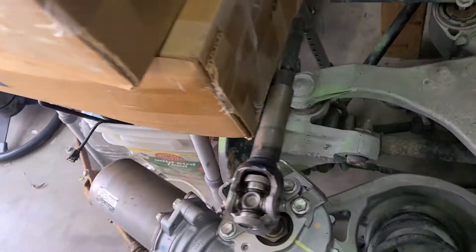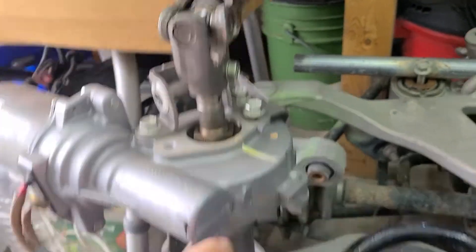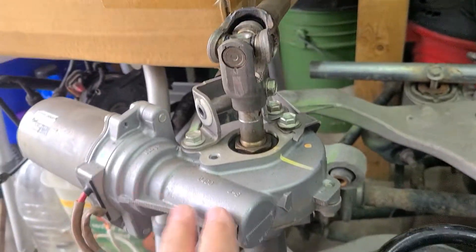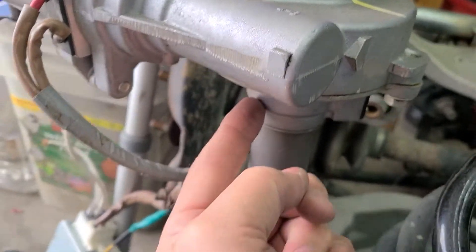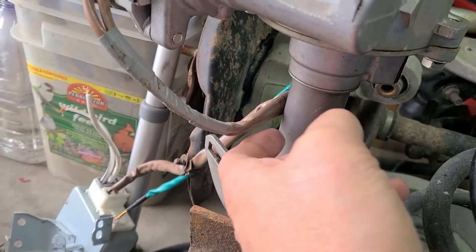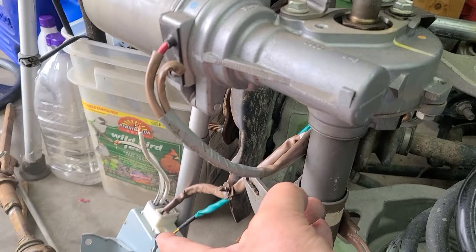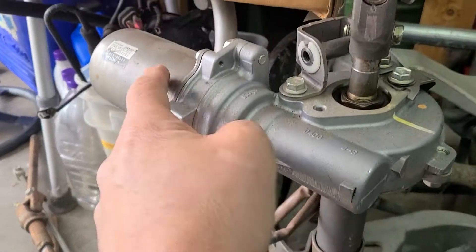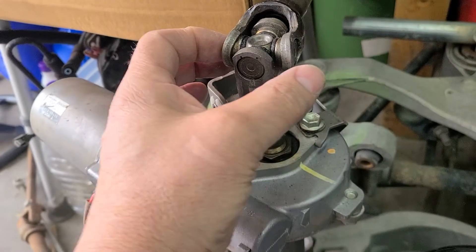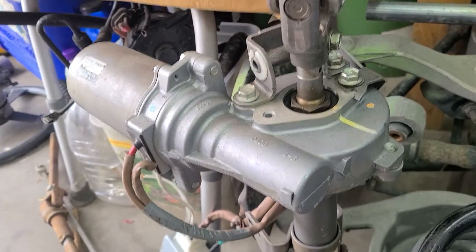What I'm going to run is a Toyota Prius electronic power steering setup. This is the Prius column with the spline shaft here and another spline shaft on the bottom. There's a little brain box on it. On this side there's an encoder wheel just like a wheel mouse — when you spin the steering wheel it sends pulses one direction or the other into the brain box. Coming out of the brain box you have 12-volt power and ground. This is basically like a worm drive and it will turn the steering shaft that goes down to the manual rack and pinion. About 99% of the original Prius column hardware is going to be gone.